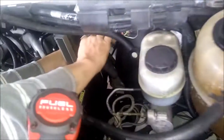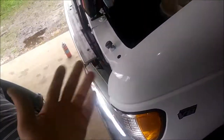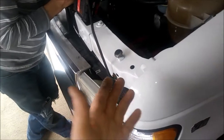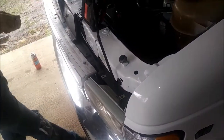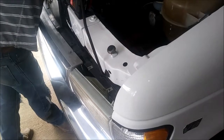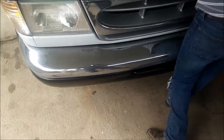We're going to try to defy that and see if we can do this with just a junkyard matchup — that's the purpose of this video. So now we're installing the new computer. We'll get back with you and let you know what it does — if it misses shift points, shifts early, shifts late, acts erratic, or if the damn thing even works. We already tried a 2001 computer with a 5.4 for an E-series van — we just had to make sure it was a 5.4 two-valve. It worked for the engine — the engine ran like a champ, no detonation, timing seemed on the money, injectors spraying properly. It even had a little more pep than our old computer.